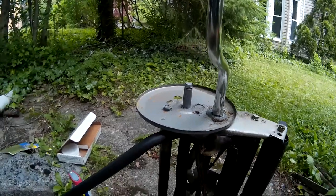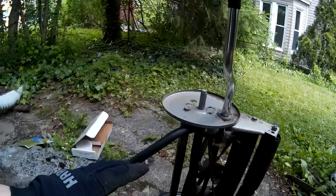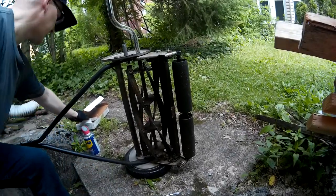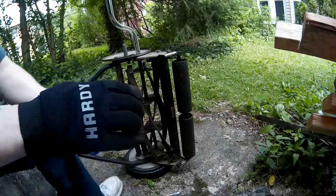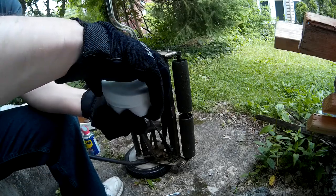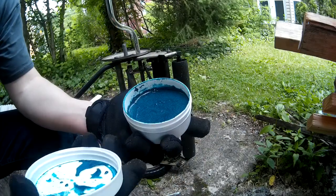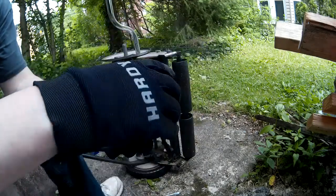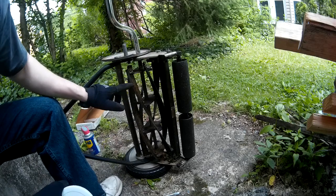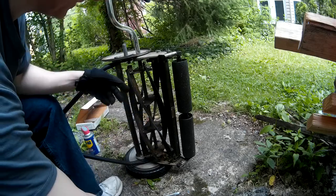This crank handle fits over top of that pawl, like so. Once you get to this point, you want to take the paste — this is the sharpening paste, and all this is is a little paste with some fine grit in it. Take that and take your paintbrush and paint it along each and every one of these cutting edges.